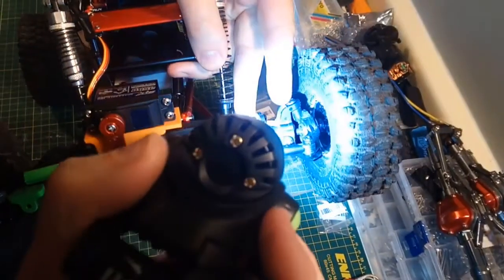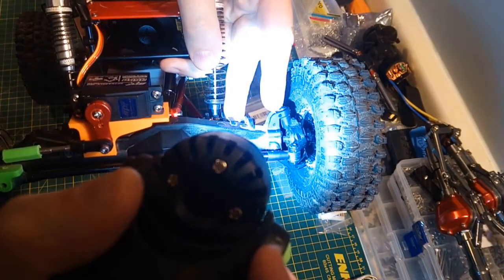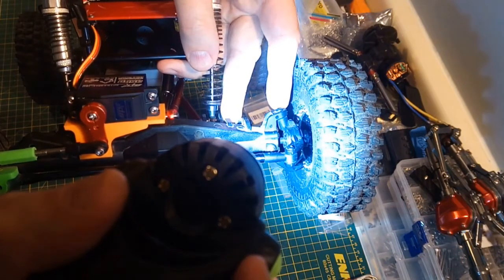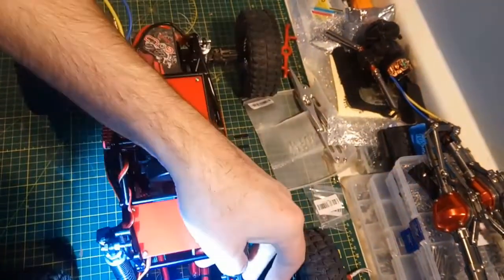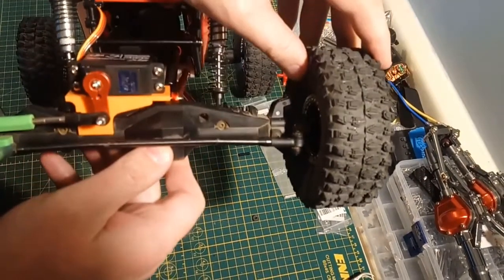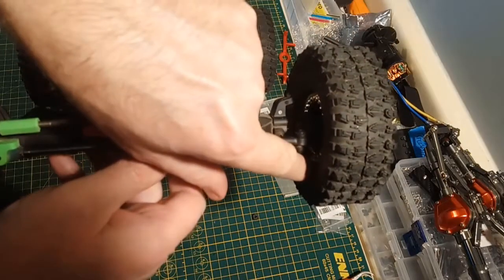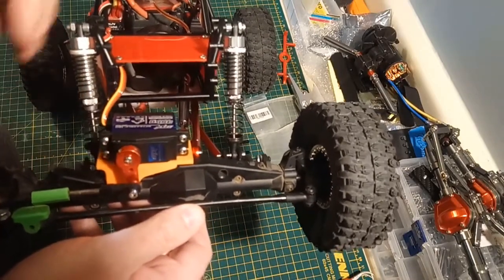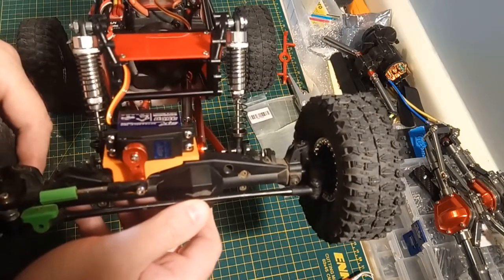This car is a little bit wider than it would be just with these axles because I am running 12mm wideners. Now, it's not camber — that's the angle of the tire. This is the angle of the kingpin. Notice how the XR247 axles have a serious angle going on on the kingpin there. That gives you good cornering performance, but the problem is it means your tire has to be farther out, so wideners. This thing is overall about an inch wider than it would normally be.